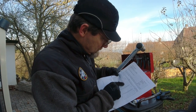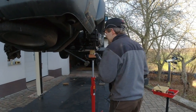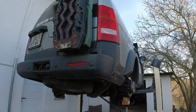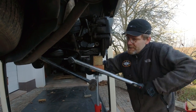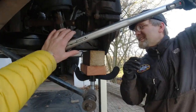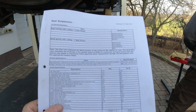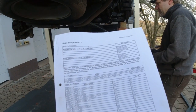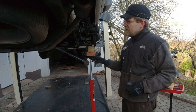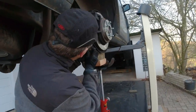Shock absorber to lower suspension arm: 300 Newton meters. Is that the one Land Rover has a different opinion about? Yes. Land Rover says 300, we are doing 275. Toe-link bolt gets tightened with 175 Newton meters. You're supposed to use that bolt only five times. We're using it about now the eighth time — so it's just intolerance, even for a Land Rover.